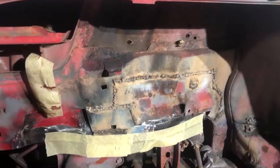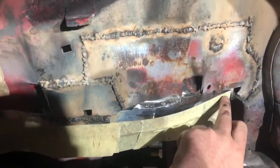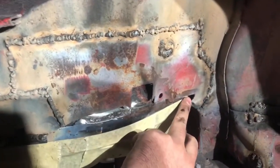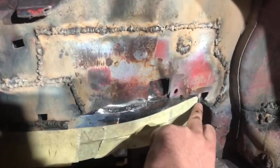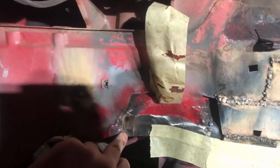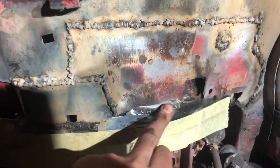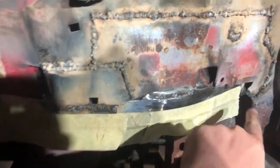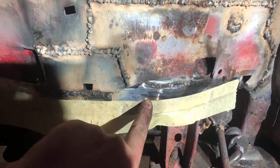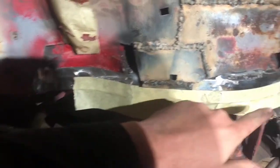I think that'll do it for tonight — I'll give it overnight for that to go hard. So I had a little bit of a late start today so I've just cracked on. I've inserted a piece of steel which tucks off all the way up until there, got a tack on it, spot welded the whole length, all the way up until here, welded it there, there, and there. This piece of steel measures out at 30mm deep and the tape line is 20mm deep, so that pinch weld is 20mm.